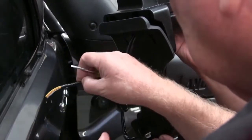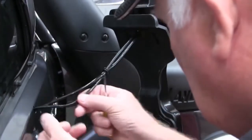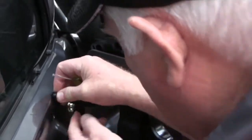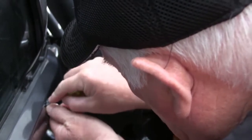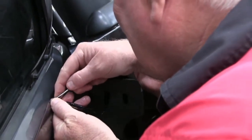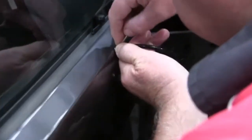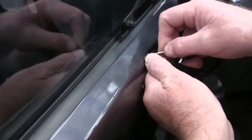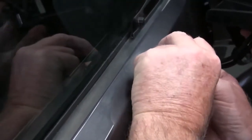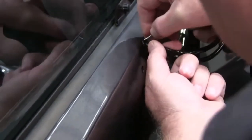Push that through there. Feed the other wires through here as well, and push them downwards. We're going to try and fit this rubber into here. Make sure you put the wires through it first because you won't get the plug through otherwise. You've just got to work at getting that into there. Fit the rubber boot in there. Once you get that through, you'll feed your wires down.